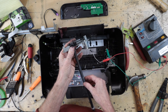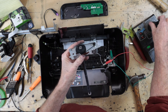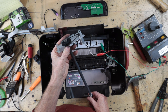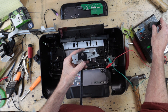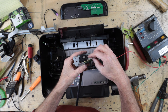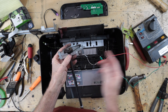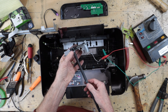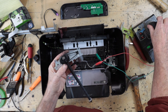We're back. I've got the paper handling part of this open and we can see it's got a nice little action. It doesn't have any bearings per se, just bushings. At the other end you'll notice it has a little optical encoder and a decoder that screws to here, and this little bit goes over a translucent plastic piece with dots on it. So it knows how many rotations it's done — because this is the paper feeder, not the carriage driver, it'll know how far to go for a piece of A4. That's quite a nice little action.